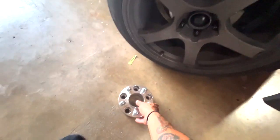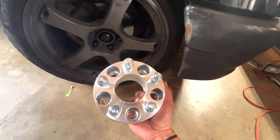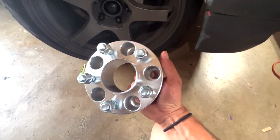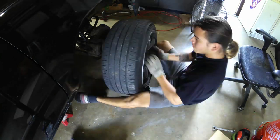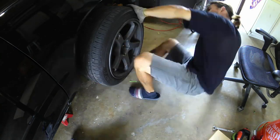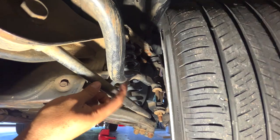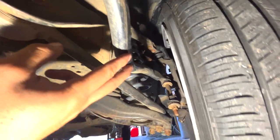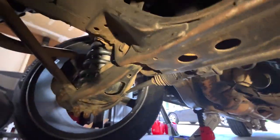The final piece I was waiting on is these two-inch wheel spacers. These are a lot bigger than I thought they were going to be, but I'm hoping this two inches of space will let my wheel make the clearance I needed. The spacers were kind of mandatory because the issue I was having was my wheel rubbing against my roll bar pretty bad, and I didn't want to have to get rid of it or move it. I threw them in and I'm not hitting anything, so I'm going to drop the car down and see if I have any hitting on my fenders.